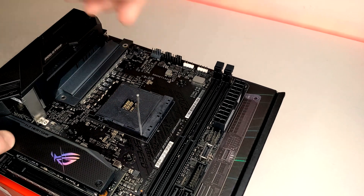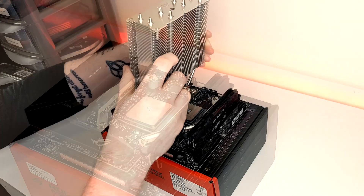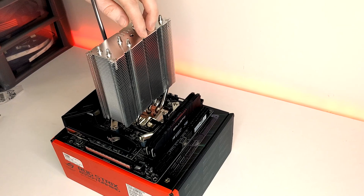So overall, if I'm being totally honest, I'm not really that impressed with the results from today's overclocking. I believe the reason we're seeing such a poor increase is for a few reasons — one being that we're running at 1080p, which isn't going to tax the GPU as much. Secondly, Ryzen CPUs come so well-binned out of the box that they'll boost really well across single-threaded applications, and even though we were beating our scores in Cinebench R20, it really didn't help us that much when it came to gaming.